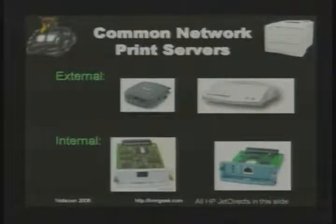I'm going to show you a picture of a couple of different common network printer servers. These are two external JetDirect boxes — one hooks up via USB, one via a parallel port. These are internal ones you actually plug into an HP printer, plug them into the ethernet jack and you should be online. You can configure them to get the IP address via DHCP. Generally you find the IP address by hitting a little test button, which lets you pull up the diagnostic sheets.